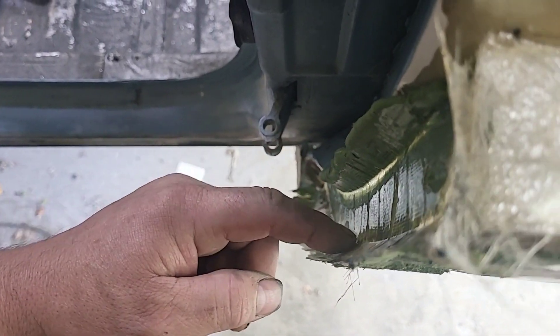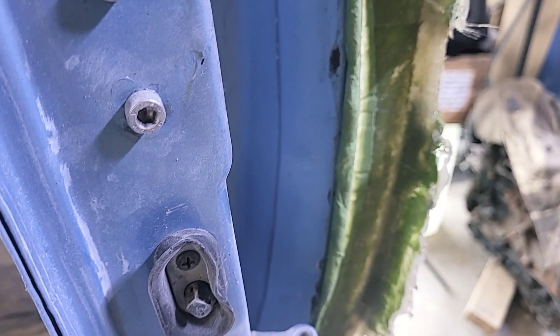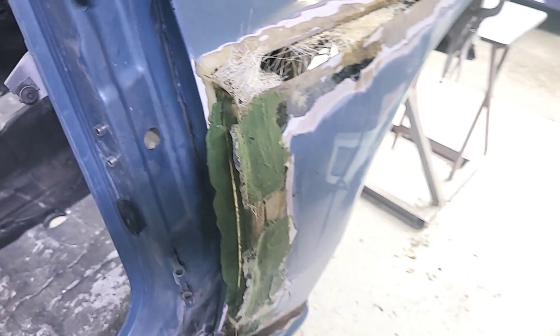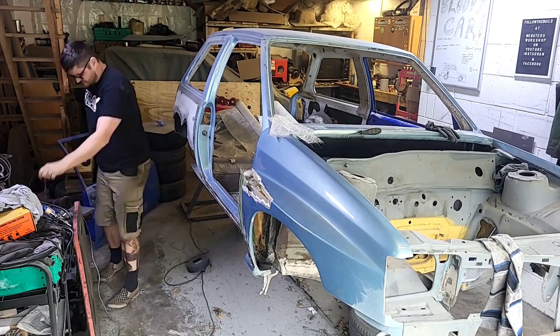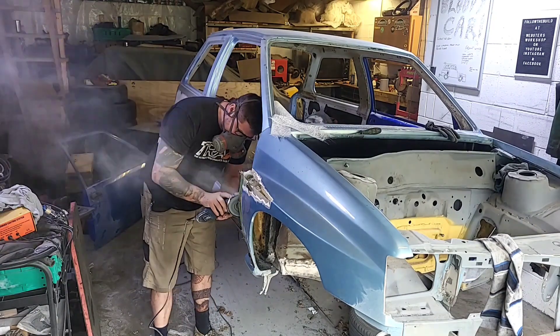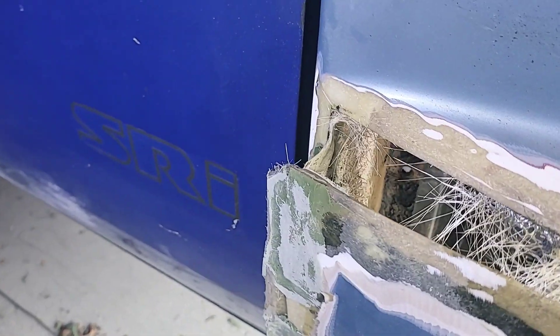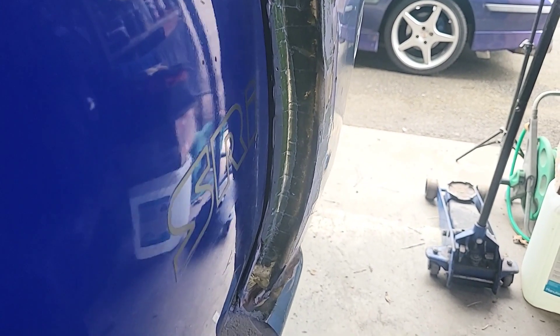It's got the little edge here and the edge here. What I'm going to do is take the grinder and clean this edge up, try and clean the inside edge up a little bit, because where I've blobbed it over with the fiberglass putty I've lost that edge a little bit. Once I've done that and cleaned up all the loose ragged edges, I think I'll take the wing off the car and get a good coating of fiberglass on from the inside. Let's get this ground back. As you can see, straight away it's a million times better.